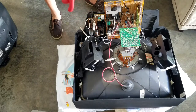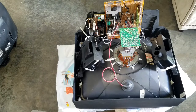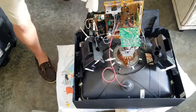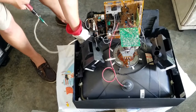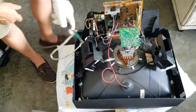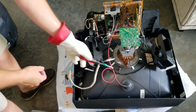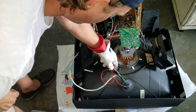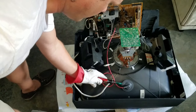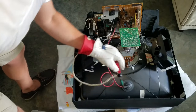I've got the CRT face down. When it's really large like this, it's really easier to work on them when they're face down. I've got my gloves and my discharge tool. It's already connected to the ground point down here where the degauss goes to the frame. So let's just get in there and tap under there and discharge this TV. I'm just trying to tap it with one hand. I've definitely touched the metal, I can see down there.